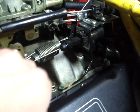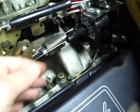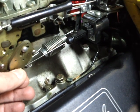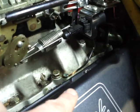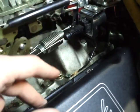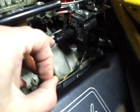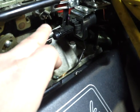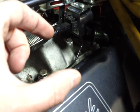When you're at full throttle, make sure this cable is all the way out. You can test that two ways. First, once it's at full throttle, pull on this with pliers or something, or when you take it off, align it at the full throttle position and see if you can pull it more — that's one way to check. Second way: go underneath the transmission, take your transmission pan off. You're going to see where this cable goes into the valve body. There's a little valve that goes back and forth with a little spring in there. Have your buddy slam the gas and hold it there, then go underneath with the cable connected and make sure that throttle valve is pushed all the way in. The throttle valve goes back and forth once you give it gas.